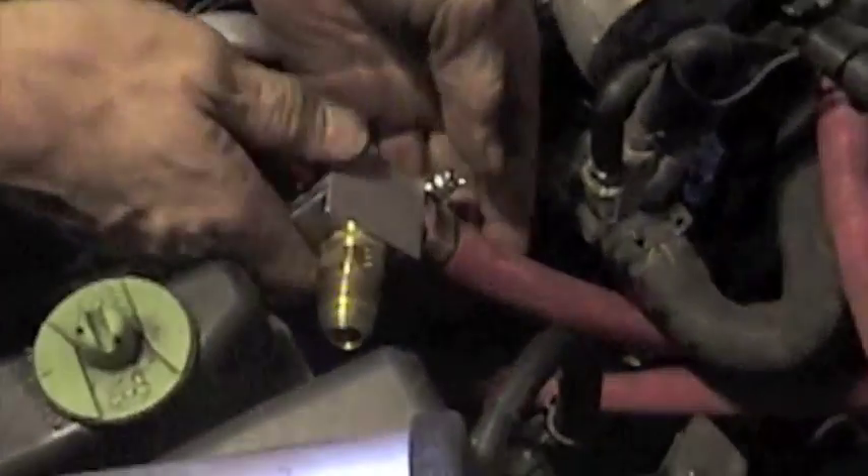We'll tighten those up. What you see now — we cut the supply on the heater at the back of the firewall, and he's going to put his T in there. We have three clamps to make that tie. We're going to route that now to our heater at the filter. Now we're going to shove it into the supply line. We've got a clamp on it. We're going to position our heater onto this flared nut, get a wrench and slide this down. We've got a few bolts onto this — it's kind of flimsy plastic, but that's what we're going to anchor our heater cord to.